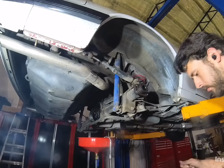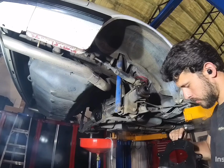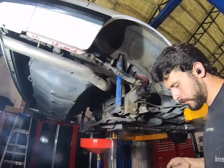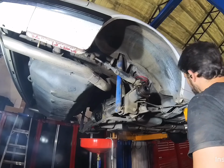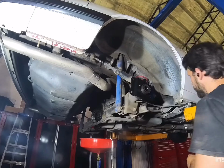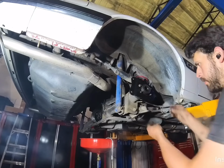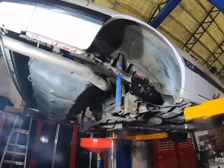Sweet. These are your new rear brake brackets. It comes marked passenger or driver side. And you do have to use the old hardware. I couldn't find the new hardware that comes with it. You will have to install these before you install your new axles. Just keep that in mind. Do not install your new axles without putting these behind them, because you'll be taking them right back out and draining all that fluid you just put in.